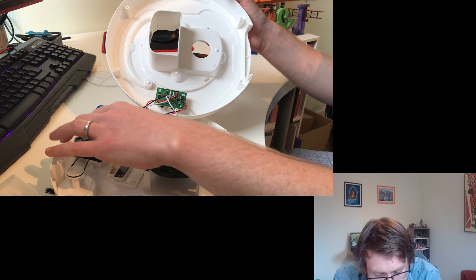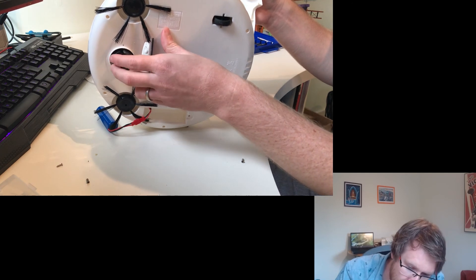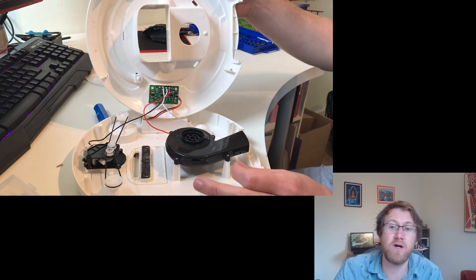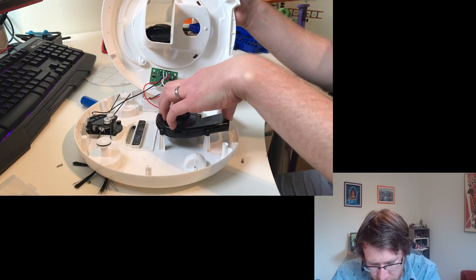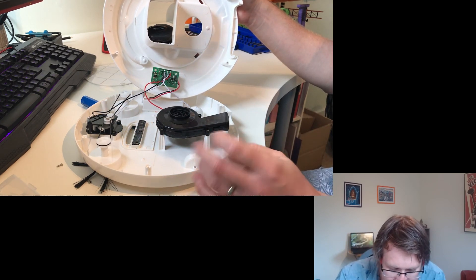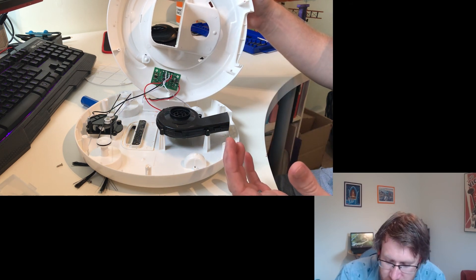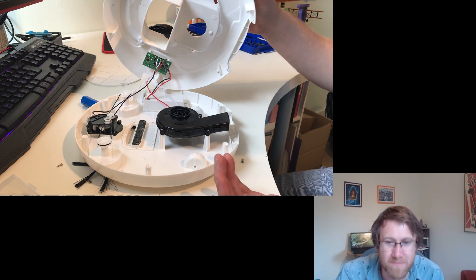Under this motor is also the front wheel, which spins — so that must be motored, and then the others are just free wheels. So for 40 pounds we have got not a lot, to be perfectly honest. We've got a tiny suction aspect and two motors. What there isn't is anything that would do any sort of cliff detection, from what I can tell here. So I think that might just have been a fluke — that it ran away from the cliff. We're going to put that pass down as dubious.